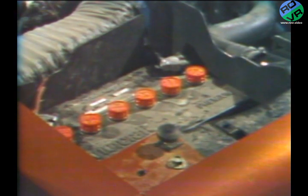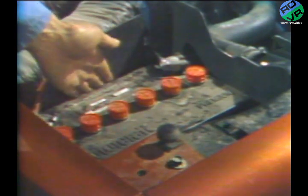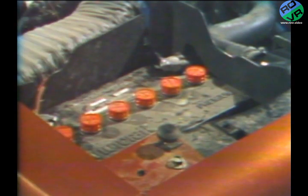Remember, we have arrived at this point in our checkout and repair of the charging system by two important preliminary steps. We have verified the complaint, and we have conducted a complete visual inspection and assured a well-charged battery, if necessary, by installing a replacement battery for test purposes. As we mentioned earlier, the problem could be the battery, alternator, regulator, or wiring, including the possibility that a ground or short circuit is draining the battery.